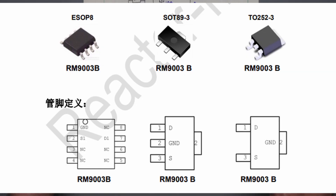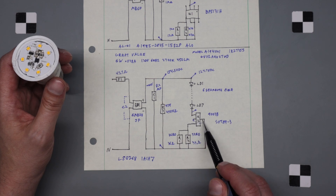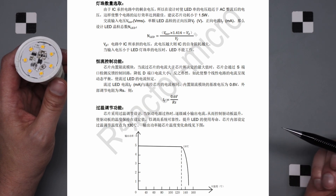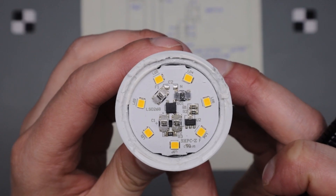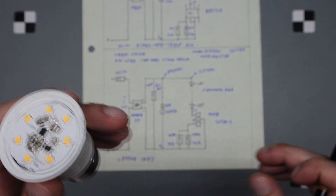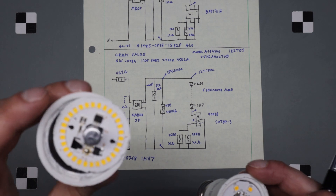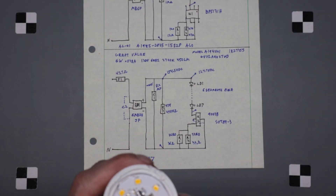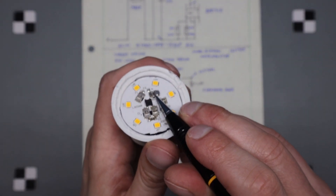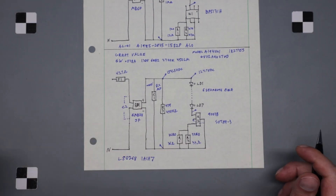Over the LEDs it was 127.7 volts DC. There's the controller chip and two sense resistors — I'll put the datasheet on screen. This one is written in Chinese but it does have calculations for figuring out the current. Pin 2 is connected to ground. This one I think would come apart easier. This one's soldered on — you'd have to remove the solder joints; maybe make the wires longer so you can pull it out more. The other one has tabs you'd spread apart.